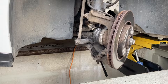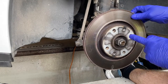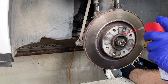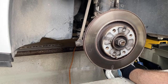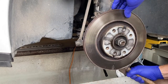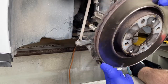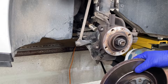I'm now going to straighten up the wheels so the disc is facing me. So now the disc is free — we've removed the two securing tabs. The disc goes around this hub centric part, around the centre of the hub. We're just going to give it a little squirt of penetrating fluid and then get the hammer and tap it side to side, top to bottom, and work it out. So that is the disc removed. All we've undone really is four Torx screws — two on the disc and two on the brake hanger.